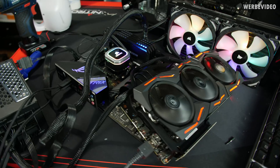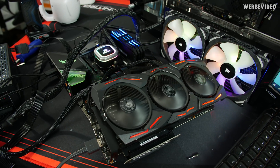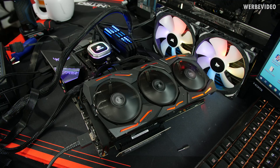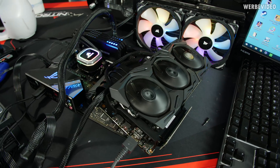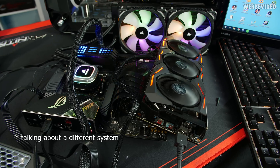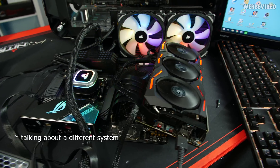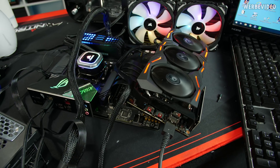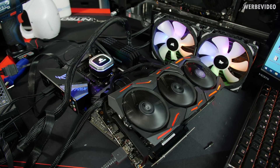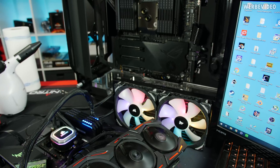You can see a display signal in Windows. I should point out that it's really necessary to use a GPU with the dedicated bandwidth. Previously I tested with a 1050 and it worked fine, but with a Titan RTX it was failing. With the 2080 Ti everything is fine, so we can proceed and mount the riser cable back into the system.